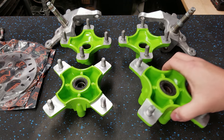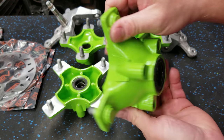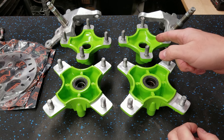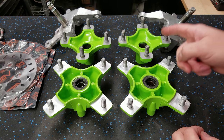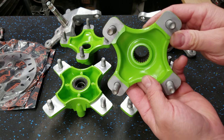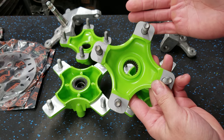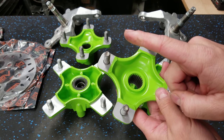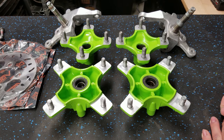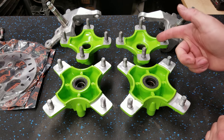Let's get back to our hubs - these things are looking clean. Hell yeah, they look great! Really happy with this color. These should really pick up the look of this bike. You'll notice we got the rear hubs here too - if you're a KFX guy, you're going to notice these are not KFX 450R hubs. These are actually TRX 450R hubs, and these are supposed to add about a half inch to each side of the KFX as a direct fit. A lot of guys do that on forums. This will add one inch in the rear, which should match the front really well because those Full Flight A-arms are plus one.